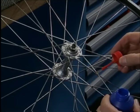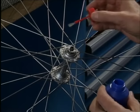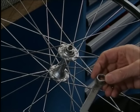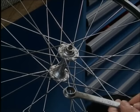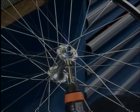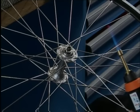As we have a lot of wheels to tie and solder, we're working with the gas soldering torch. This way the work goes much more quickly. Here also, we must apply the flux on each tie before soldering. We tap with this box end wrench, 14 to 15 millimeters, when the soldering is almost finished, to knock off the excess tin. We heat up the ties until the tin starts to melt on the soldering wire. At this point, we've reached the correct soldering temperature.